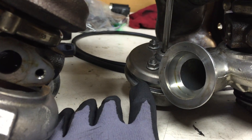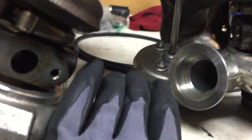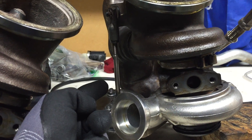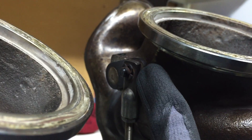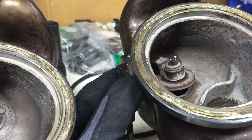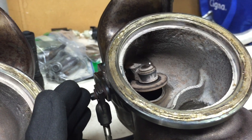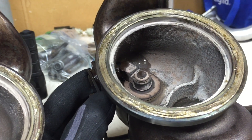Essentially, you have right here a vacuum actuator. The computer pulls vacuum on this component and a diaphragm moves downwards, which then pulls this push rod downwards. That's attached via a clevis at the end of the push rod, which pulls a lever that should close the wastegate. In order to generate more boost, this pulls down and the wastegate closes. This is the natural position with no vacuum — the computer turns solenoids on, the system gets vacuum, and boost is generated.